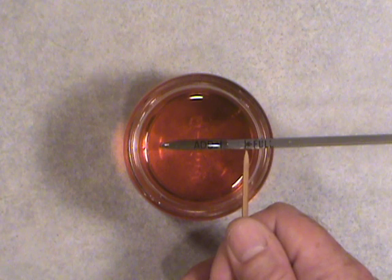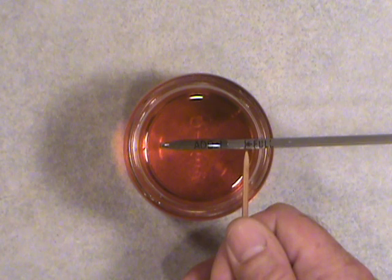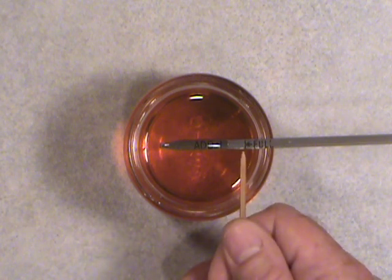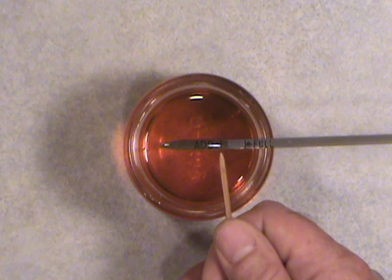Like I had mentioned, the oil will start to foam, and your oil pickup for your oil pump will start drawing in air bubbles, and that's not a healthy thing for your engine. So you want to keep it right in this range here, but never over full, and I'd never want to go below the add mark, that's for sure, especially when you're traveling down the highway and those engine revs are coming up pretty high.